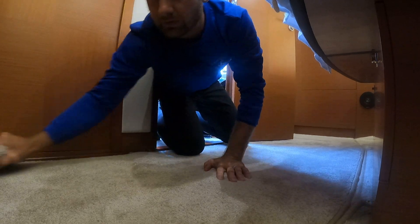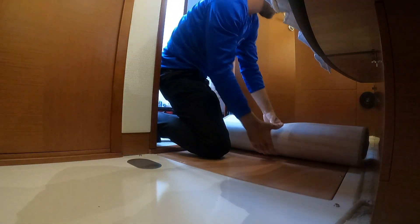Typically if a sending unit is in the holding tank — the waste holding tank — there's stuff floating around in there: toilet paper and whatever else that's likely getting clogged onto the actual sending sensor, getting it stuck. Not an easy job, not a hard job, not a clean job. We're going to have to pop the sending unit off the top of the tank, remove it, likely clean it out and descale it.